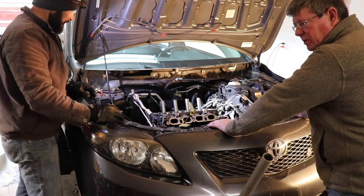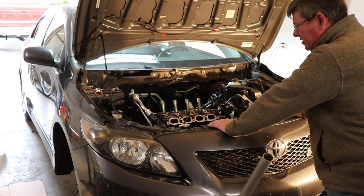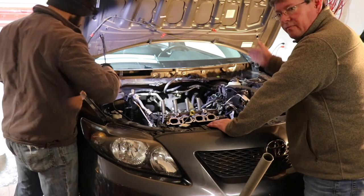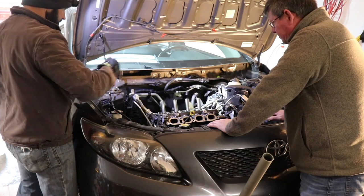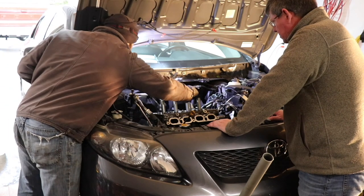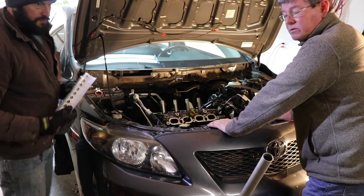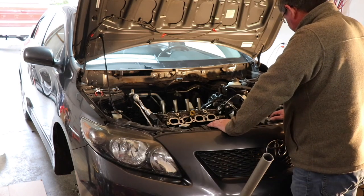So the head gasket that we replaced was a three ply, versus the other one the factory had, which was not. This is an aluminum head, so it will flex. It'll move if you don't torque, like I just explained to you about torquing them down. First the first cylinder over to the third, fourth cylinder, and then back and forth to tighten it down flush. Gotta have a flat, smooth surface. And you want new head bolts. Don't use the old ones. Yep, they're cheap enough, but this is a big enough job you don't want to do it twice.